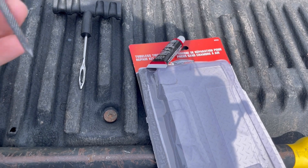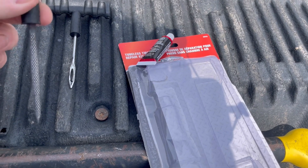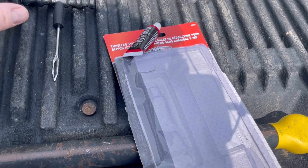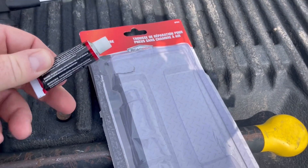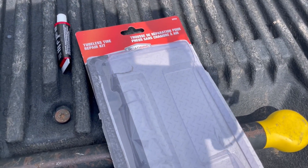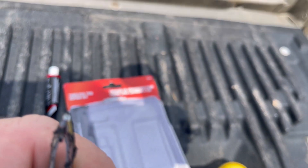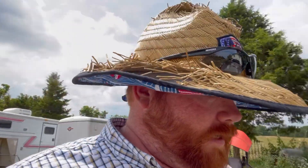There's the file basically. So I pulled out the nail - I didn't film any of this. You shove the file in until it moves in there good, it roughens it up. Then you take a plug, put it through that little eyelet, cover it with a large amount of cement, and then shove that in the hole. You can see it's open right there on the end, and the plug stays in the tire, plugging up your hole. The cement just holds it all together. Then all I had to do was put air in it, and it made it.